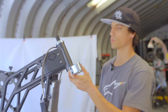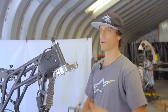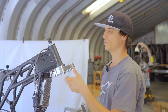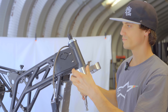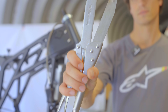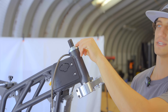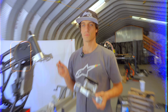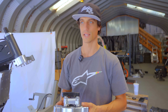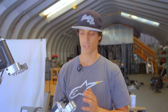Now that we're starting to put the steering stem together, one important thing to look at is how tight the top nut is. I like my steering stem relatively tight — I don't want it flopping around or giving me head shake when I'm riding. The tool I'm using is a clutch holding tool from Motion Pro; it works great on the top steering stem nut of the RTR. You can also use a soft punch and gently tap that with a hammer to get it a little bit tighter. One thing I do want to point out about these clamps: this isn't the final design — this is the first iteration, a prototype Rev A. When they're available to the public, they might look a little different, but this is our starting point.